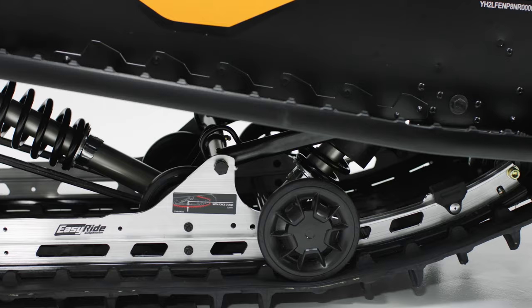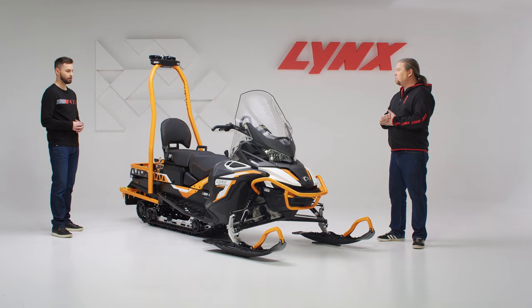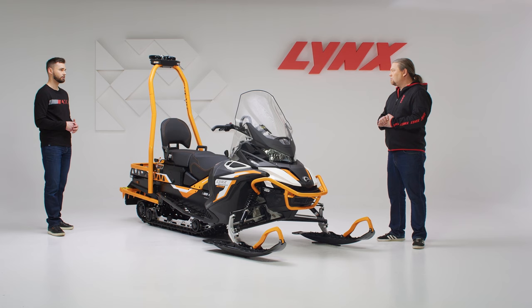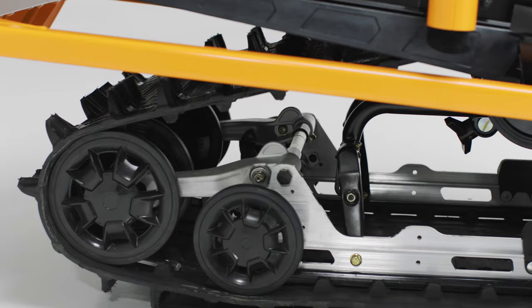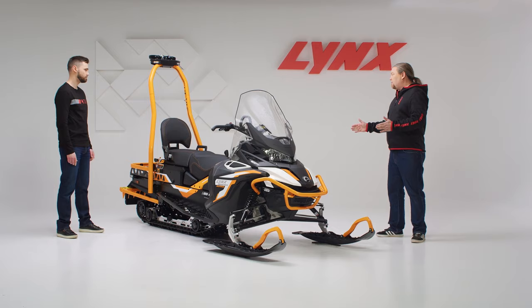The EasyRide A rear suspension is tailor-made for utility usage. It can carry a lot of load while still maintaining good steering so the skis remain on the snow. There is also a rear extension: when you reverse it goes up to help you stay on the snow, and when you go forward again the rear extension goes back down. The 59 Ranger Alpine also has a locking mechanism in the rear extension so you can fix the rear wheels down.